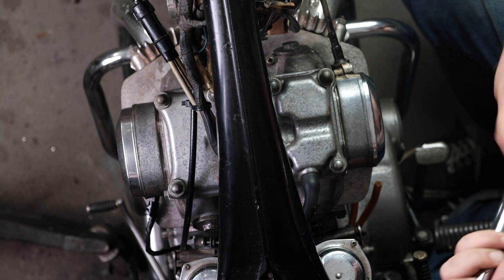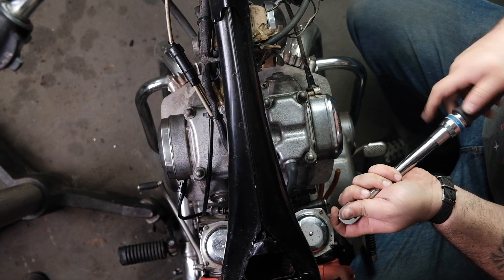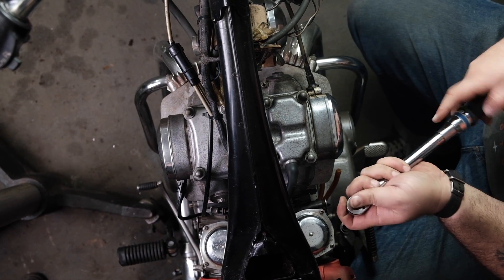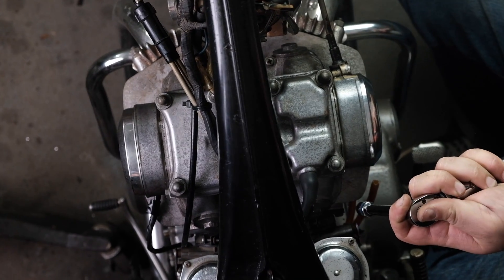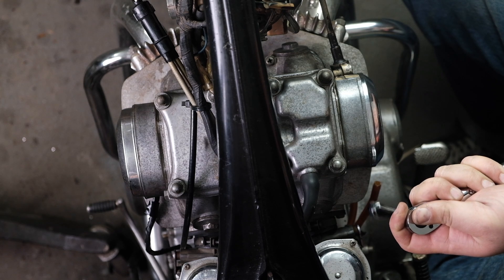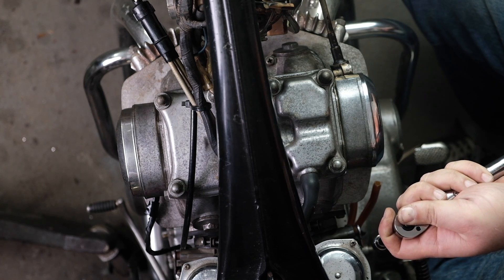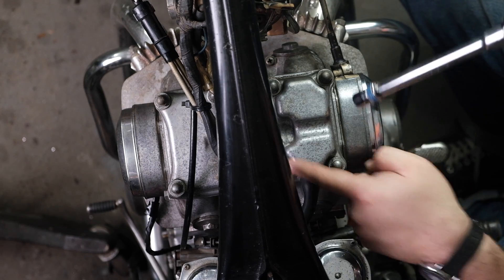Let's bump the wrench up. I'm going to go to 158 now — that'll be our second stage. All right, that is 158 right there. Same sequence, starting here at number one again.